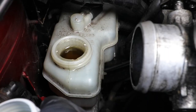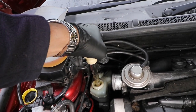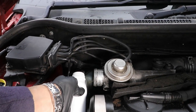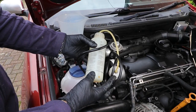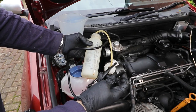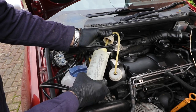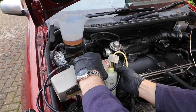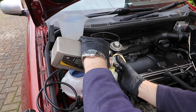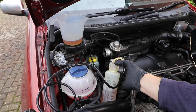You can use this method to change out the whole brake fluid in the system, but it is quite tedious. I'd recommend you take out all the fluid in the reservoir prior to doing that — you can do this with a turkey baster. A much better method of changing out the whole fluid is to use a one-man pressured system. I've used this little pressured system for many years without any problems. This one's a Gunson Easybleed. It comes as a plastic bottle that you fill up with new fluid — this is DOT4.